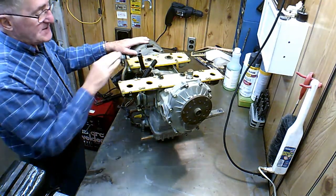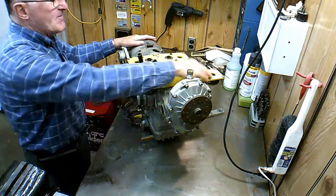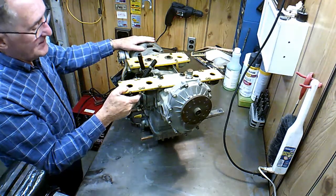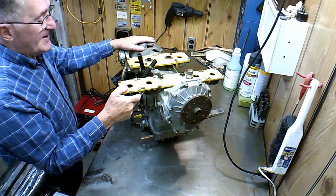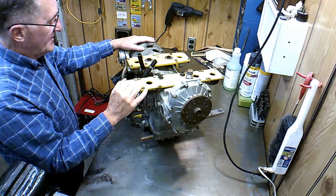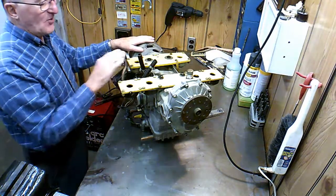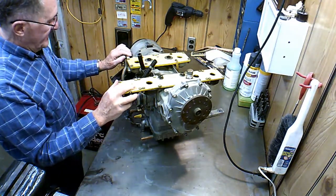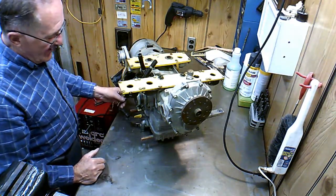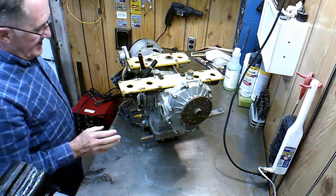These motor mounts are my own. These didn't come with the Chinook. It's probably overkill. I've got four motor mounts on this bar here and just two on this bar, but I got to thinking, boy, what if that engine came loose, or I lost a prop blade or something and it really got to shaking. I kept thinking, boy, I don't want a really weak motor mount on there. I've got to have this thing mounted on there real well. So that's the reason. It's kind of overkill on this mounting system, but I just kind of scared myself, I guess, about it. There's modifications to the wiring here that I made too.